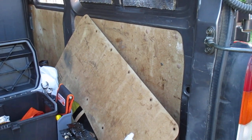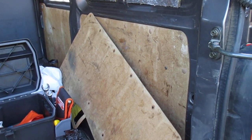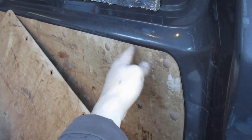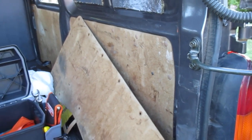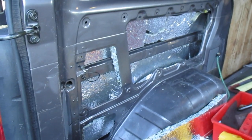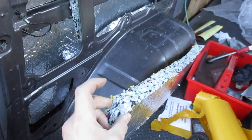Alright, so this is the back of my van and I'm doing some sound proofing on it and I figured I'd just do a little demonstration of how well that actually works. So this is how it looks originally — you just have this very thin cardboardy sheet which is stuck onto the bare metal and there's nothing damping the bare metal. And on the other side I have basically filled it up with this cheap foamy damping material.